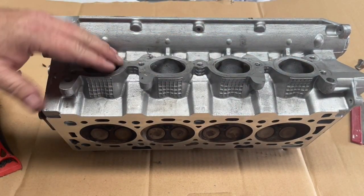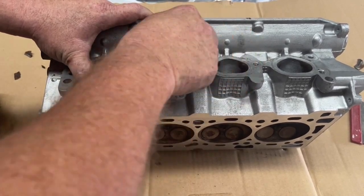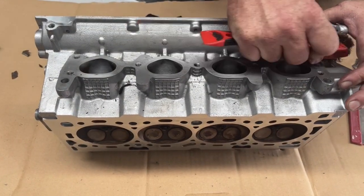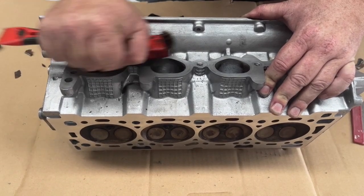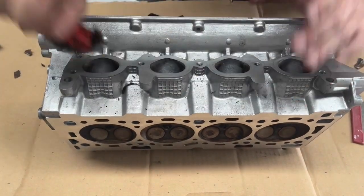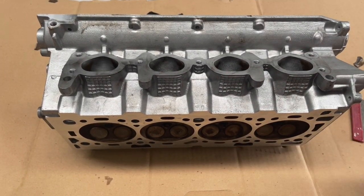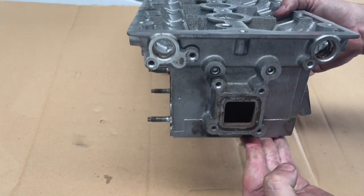This particular one — I don't know why they had a cork gasket, but there's also silicone on here which you wouldn't normally expect to find. Another important one to clean up before we put it back is the thermostat seat. It is a common source for leaks, so we'll clean it up now.